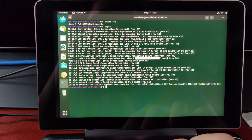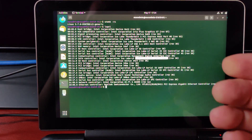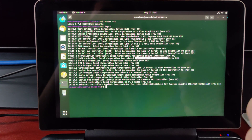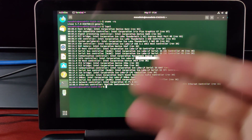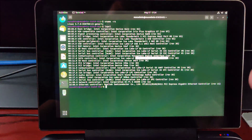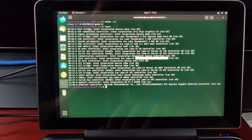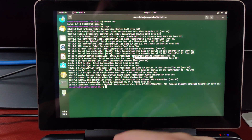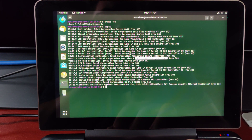I didn't really have to do anything to get Linux to install on a disk with SATA. But when I had NVMe on, it wasn't immediately available. Unfortunately I'd have to go and redo everything to kind of see what would be necessary to get NVMe to install on. But right now I can verify that you can install against the SATA controller.